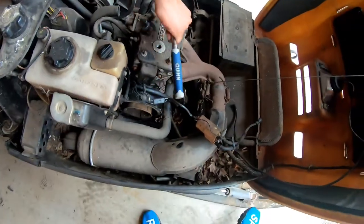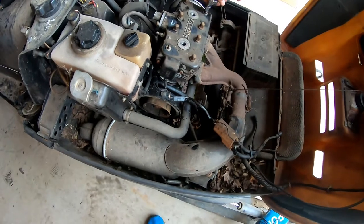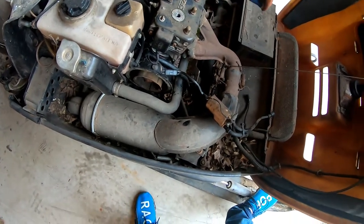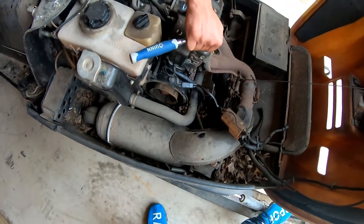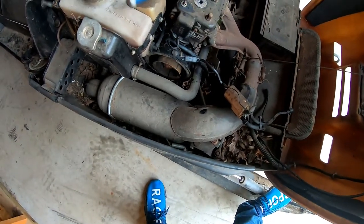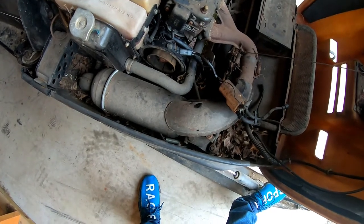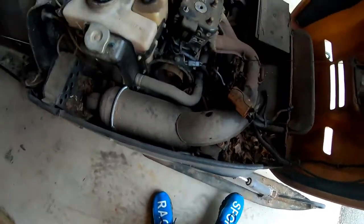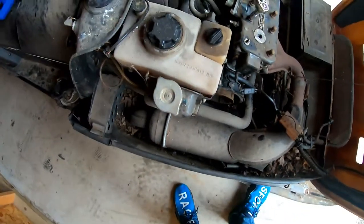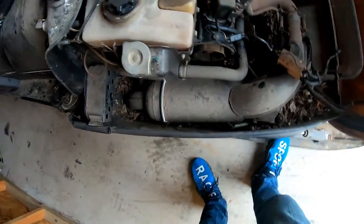I'll go online and see if there's a motor available, if somebody has a used one for maybe $50, or one with a junk body and swap over. Otherwise, we'll just part it out. It's got a good CDI coil, NipponDenso most likely, for a lot of Ski-Doos. Those can interchange. Exhaust, clutches, and the hood are always worth something. Or maybe I can figure out a way to put that Polaris 340 Indy motor in this thing.